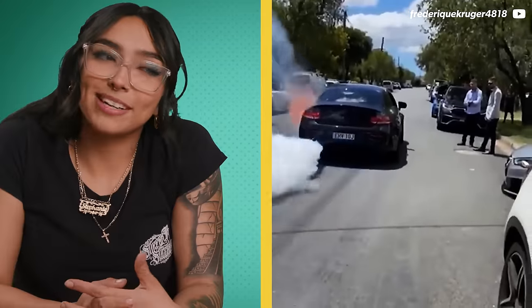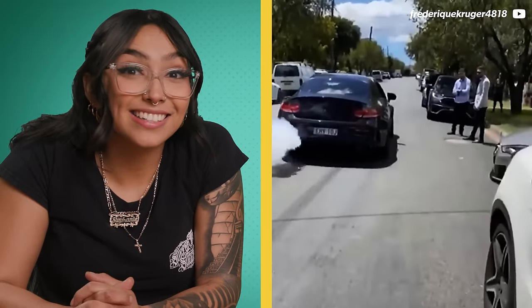Okay, Sandro, how much in trouble is my man right here? What are we looking at? He held it so long, he could have blown turbos, he could have overheated it. He caused a fire, whatever else. Whatever that is at the bottom, I don't even know what that is. I'm gonna assume he didn't turn off his traction control. You see the white smoke coming out of his exhaust. Something bad happened with coolant. I'm gonna say he blew his head gasket just because of how great and dense the white smoke is. He definitely blew something, that burnout. And his ego.